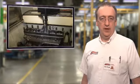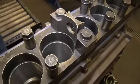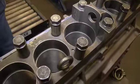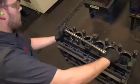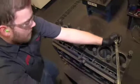One reason is our process of torque plate honing the block. A head gasket is placed on the top of the deck surface and a steel plate is bolted in place. The bolts are torqued and threaded to the correct depth as the head bolts would be when the head is installed.